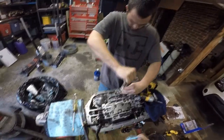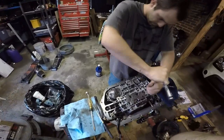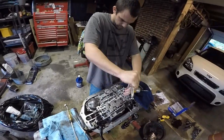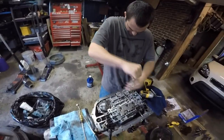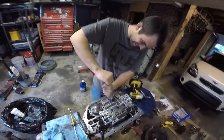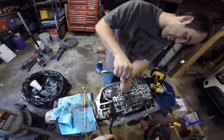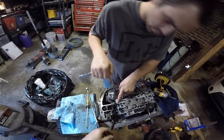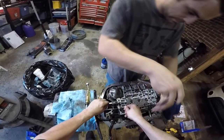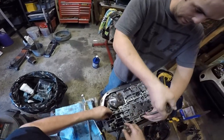And spark plug tight again. For reference, for people who have a history of stripping out spark plugs, spark plug tight is like 18 to 24 foot-pounds max. I want to say 18 is probably tight for these. I don't remember exactly. Oh yeah, maybe they're 12. Oh, I gotta take that back out. They're in the teens. Whoops, I forgot. There you go.